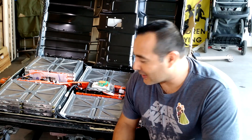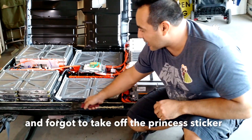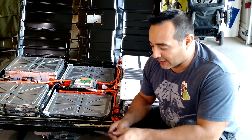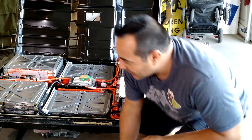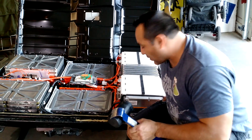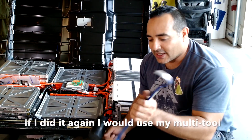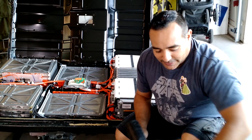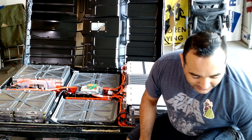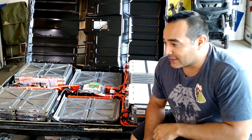Getting the battery apart was pretty hard. I initially started with a little putty knife, going around trying to cut the pretty thick seal of glue surrounding the whole thing. I moved on to a bigger one — I didn't really care about the top. It took me about three hours to open it to this point. This is the inside of a Nissan Leaf battery.